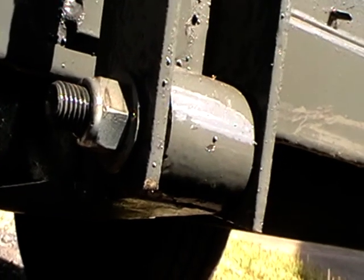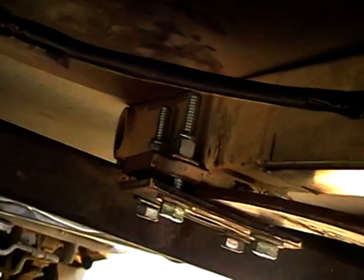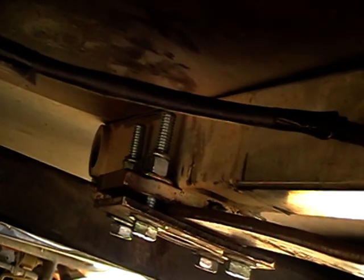The spring is attached at the front with a normal eye point, then goes underneath the trailer and is trapped by a mounting point. The end of the leaf spring is cut off — there is no loop — and it goes through two plates: one is welded onto a center spine that I welded into the trailer underneath, and it bolts together with substantial bolts and lock nuts. There's a fair load as you stress it up, so you need this quite substantial and welded up solid, but there's nothing major mechanically — just a basic clamping system with four threaded bolts.